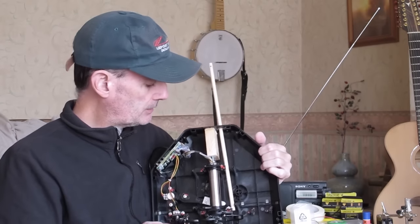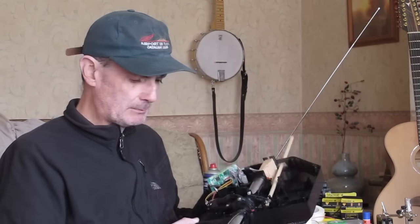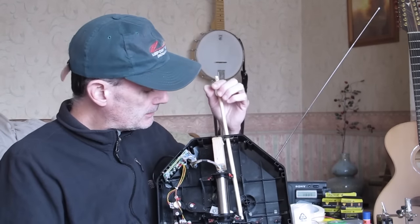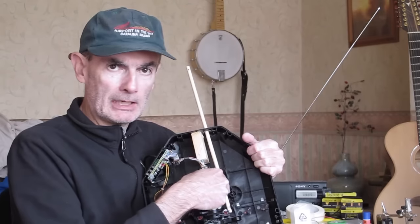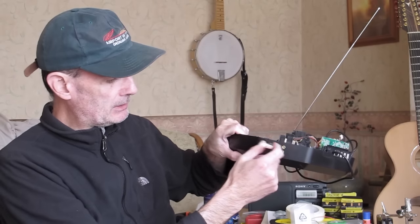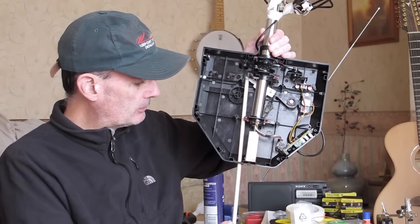The other thing that you'll see if you look closely, I've got this block which is now preventing the shaft from moving in and out, which was the old elevator action. And that's about it, really. It's fairly simple in principle, with a few wrinkles in the implementation. Most notably, if you watch this rod as I pull it in and out, because that crank tip doesn't travel in a straight line, it actually travels on an arc, that makes this setup a little bit more complicated. And in particular, the exit hole at the end has to be elongated. In fact, if you just watch that dowel down at the bottom here where it leaves the case while I operate it, you should see it wobbles about across the cycle.